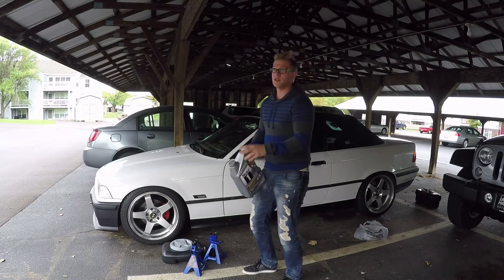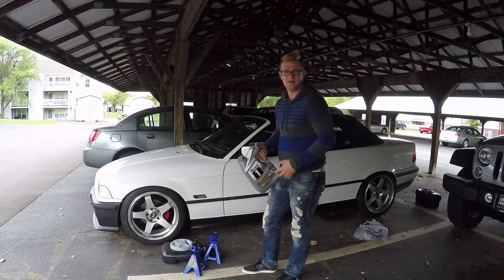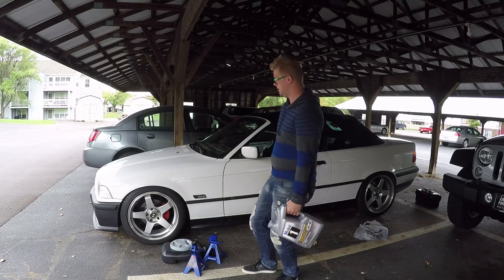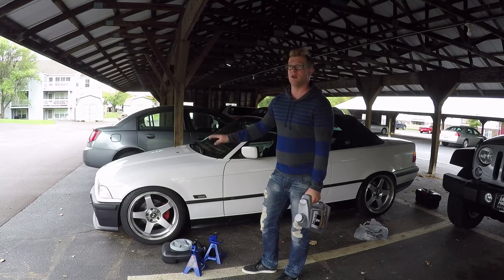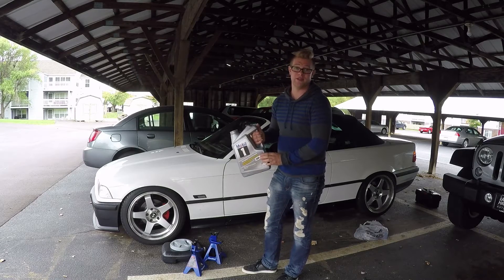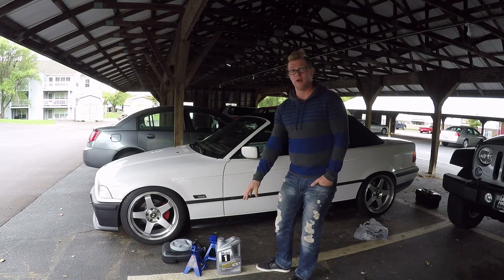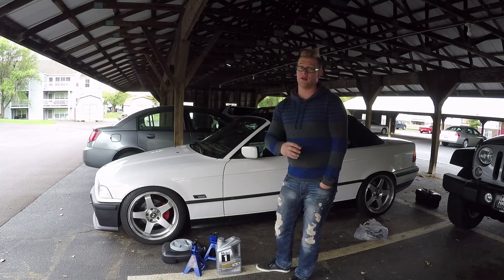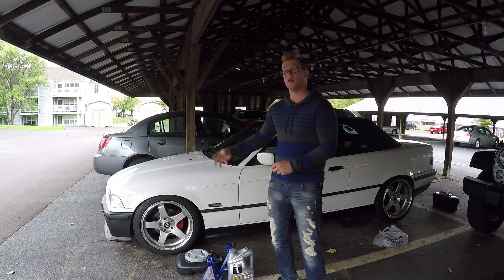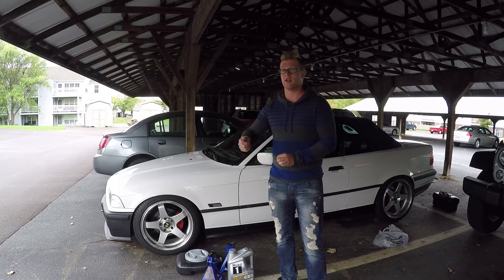On a cold start — and that doesn't mean a 30-degree day — it's anything below about 120 degrees Fahrenheit. That's like normal oil sitting in your engine: if you waited a whole day to start the car and then started it, that's the viscosity your oil is at before it's been running for a while. The higher the number, the thicker the viscosity; the lower the number, the thinner. The benefit of a lower number is that the oil gets circulated through the engine a lot faster, which limits metal-on-metal wear during start-up and warm-up.